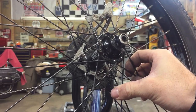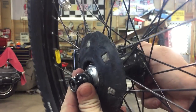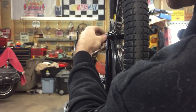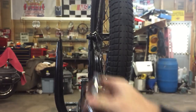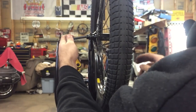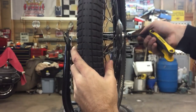The last tip is essentially the same as the first tip, only using it with a female axle. The situation is that you've tightened one side down too much, and no matter what you do, when you tighten both sides down and try to break them free, only one side will break free and you can't get the other side to loosen up. Make sure you don't have a peg on the side you need to put in the dropout, then just put it in the dropout and tighten it down. The front is a little different than the back because an extension doesn't fit into the dropout the same way, so you either have to use normal allen wrenches or a short allen socket that fits between the dropouts. Just put your wheel in there with the stuck side facing out, tighten it down, move over to the side that's stuck, and it should just loosen right up.